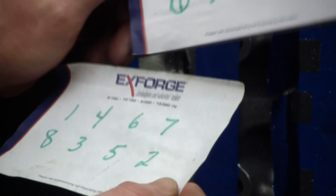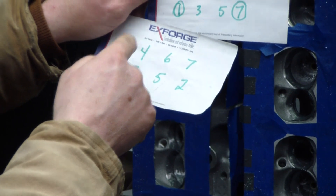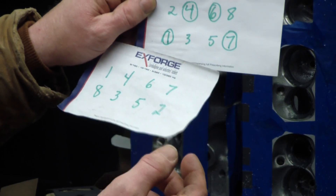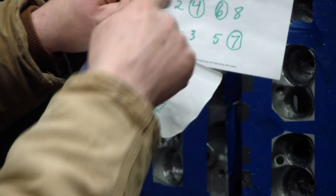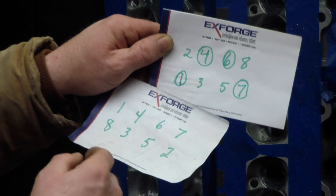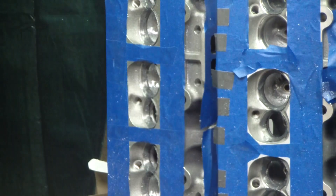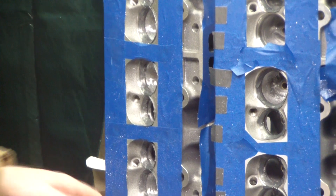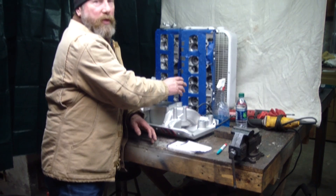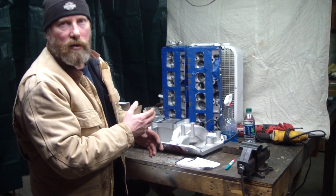You'll notice on paper that if you go 1, then 8 is only 90 degrees after it, the next one would be 180 — so it would be 4. And then the next one would be 3 and then 6. So I circle the ones that would be banged together. Usually in a V8 you've got two inside over here, two inside over there that would like to be with the other side. It complicates the passageways of the intake manifold.